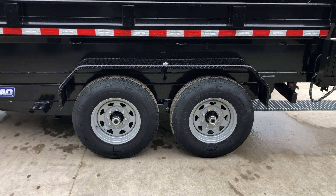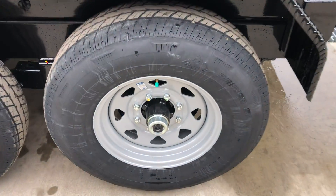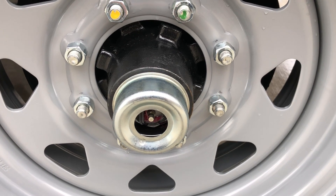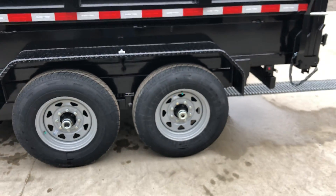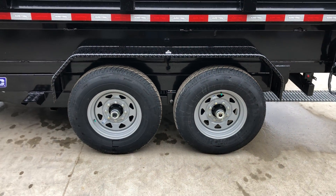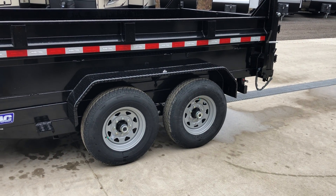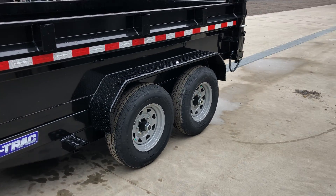On this particular one there's a silver wagon wheel with the newer style forward adjusting brakes. Behind the black cap on the end of the hub you've got easy lube bearings — when new they're pliable, and you can just take a grease gun to do your bearing maintenance fairly simply. Also, if you notice the green cap on the tires, that indicates a nitrogen filled tire. Nitrogen doesn't have the humidity that air does, which gives you a longer lifespan before dry rot since there's no moisture inside the wheel and tire assembly.